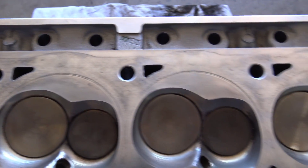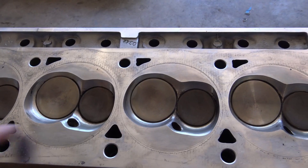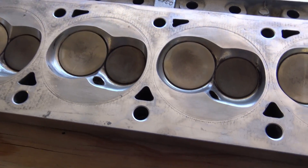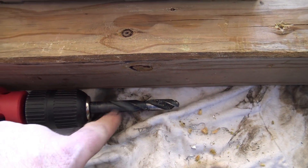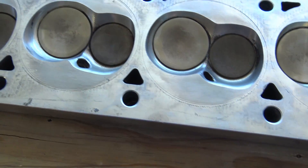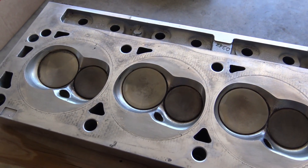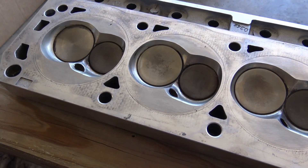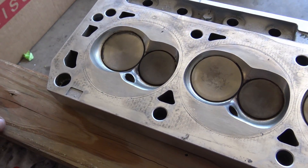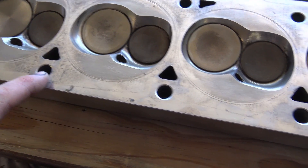Overall this wasn't that bad to do. What I did is I taped off everything except for the holes I'm drilling, so I don't get shavings in places I can't get them out. Got me a 17/32nd bit here — solid, bigger than half inch. Looks like the air base is in full swing today interrupting my video.